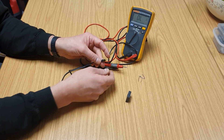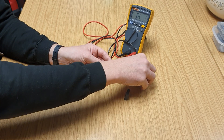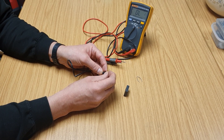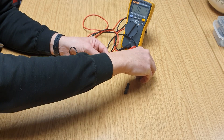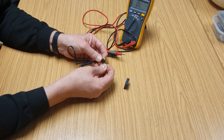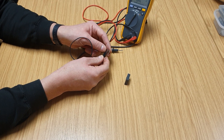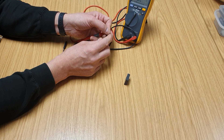The next thing you need to do is attach the ends of your probes to the end of the connector. On my connector here there are just two wires. If your speed sensor has got three, four, or five wires then it's probably not a magnetic speed sensor and you'll need to do a different style of test. I'm going to use this paper clip, which I've cut in half, and insert the ends into the connector to allow me to connect my probes more easily.